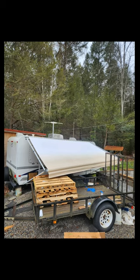The only thing I'd do different, if I had anything to change, I'd go ahead and drill that second hole like we did the first one. Clean the strip grooves out, spray them with WD-40 or something. I didn't do that. And if you could get a helper for a few minutes just to help you guide the ends of the awning in as you pull, that would help. And they could run the roller just in front of that strip as you push it in. That would help a lot. But it's possible to do it yourself.